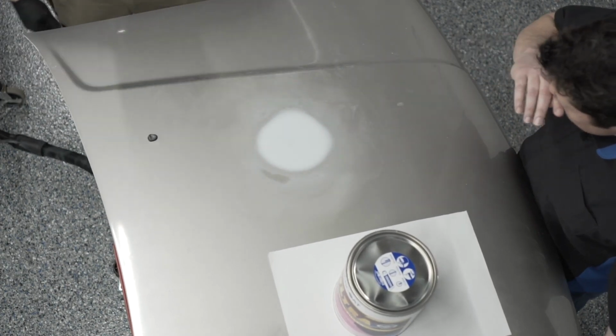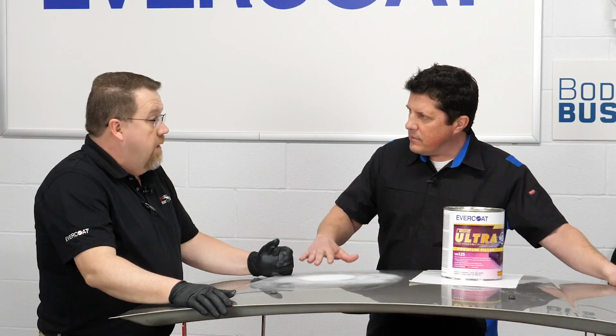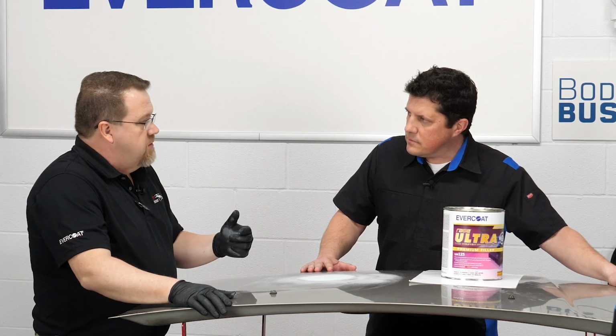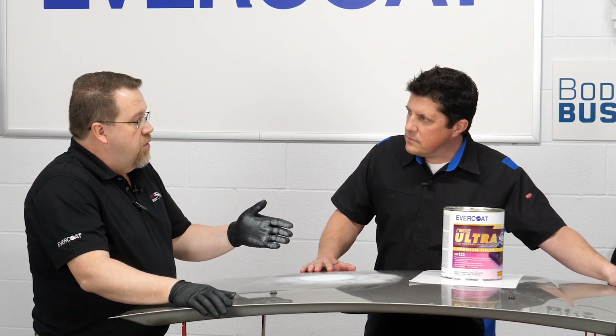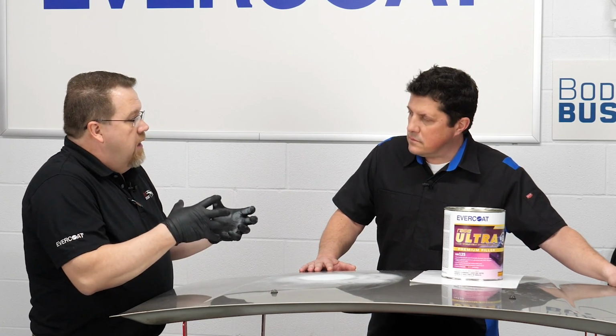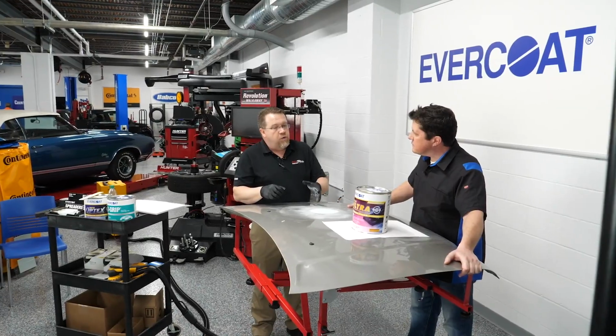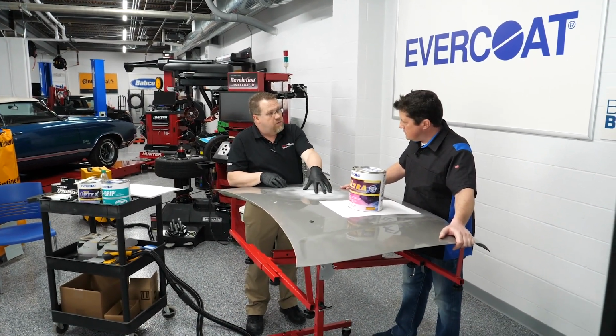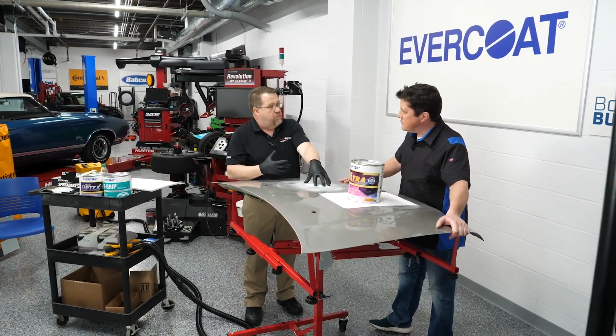I know, Tim, we were talking about putties and fillers earlier, and if this is a filler, how are you able to do that? Oh, that's a good question. Well, I was talking about the differences in the resins. This particular product uses a resin we call eco resin. So it's a polyester resin, but it's blended with our own proprietary patented process of a new eco resin. The eco resin gives us a wider range of substrates, so it's able to go over top of a sanded clear coat, something that was unheard of for many fillers.